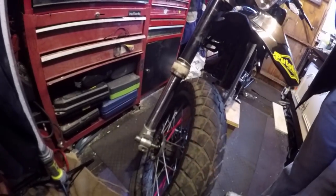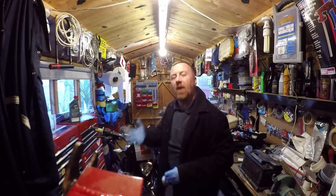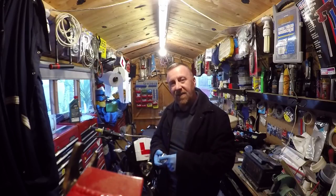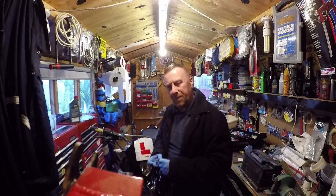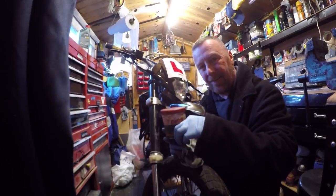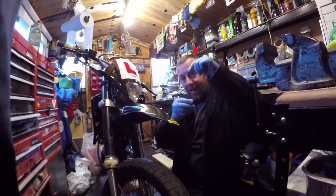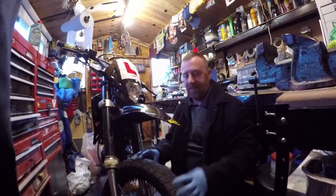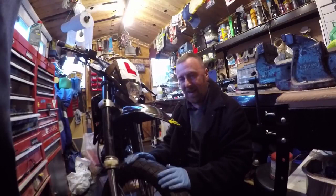All I've got to do is fit this back on the wheel and then we get the speedo going. Change the plug, put the oil in, clean the air filter. My quick tip of the day: grease the inside and where the cable goes in — grease in here as well, inside and on top. The reason being — this is what happened in the first place. Water gets in, starts rusting it. So a nice big wad of grease inside and on top, then screw back down again. The water won't get in, won't rust, and it will stay working. Such a common little thing with such an easy fix. That's where they all go — where they're made it doesn't rain like here with all the crap salt and God knows what else — why they only last a couple of thousand miles.